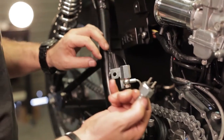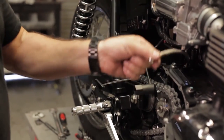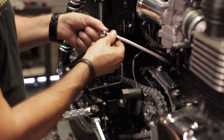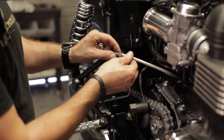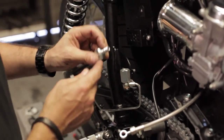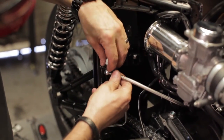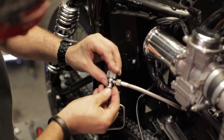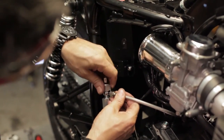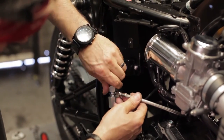This piece is obviously your brake light. Once we have this all buttoned up, our brake line to our rear caliper sits here — this is the custom one we put in place with the custom banjo. We left it loose so we can jimmy it. You've got a washer here, so your brake switch now goes into the bridge in there like so, and that's where your rear brake line connects. Obviously without it, you're stopping with the front but not the rear.